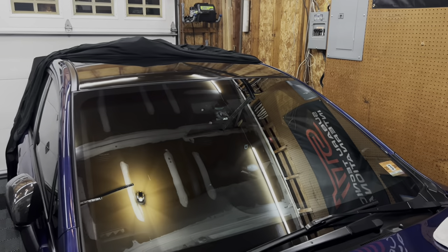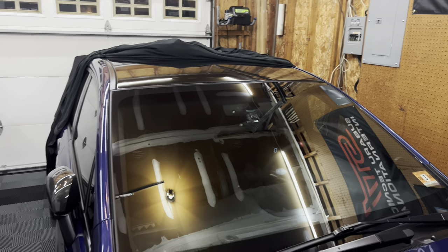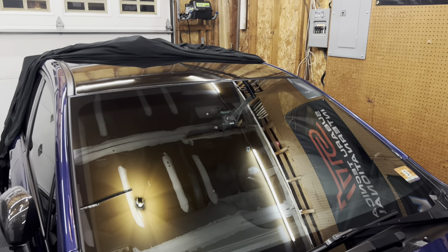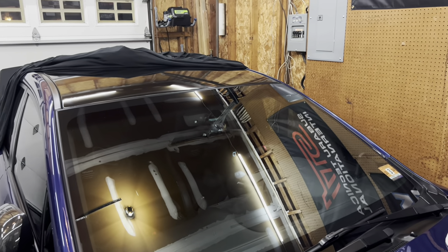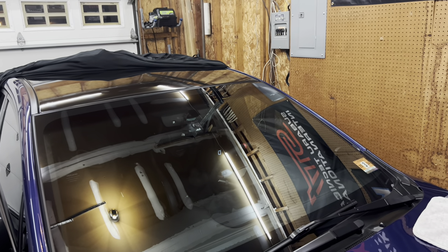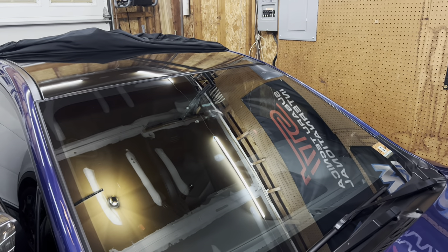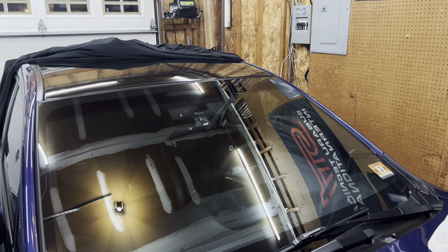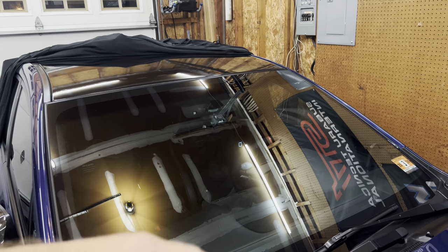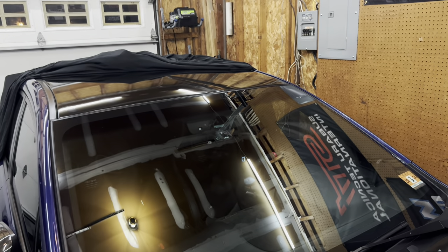It's actually been a little bit longer than 15 minutes — I waited about 40 minutes simply because I'm in the garage with no direct UV light or sunlight. I ended up using my heat gun, just waving it over a little bit. Heat from a heat gun and UV rays from the sun are very different, but I at least wanted to try to let it cure as long as possible. Now I'm going to remove the little plastic square, clean up the residual, scrape off any excess, and then we should be done. Let's check out the final result.